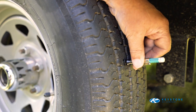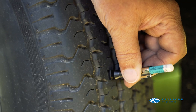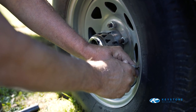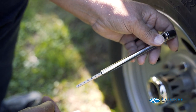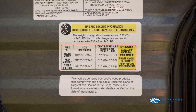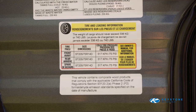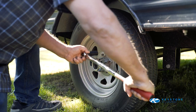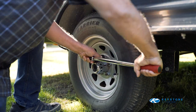While inspecting the tires, you're looking for uneven wear, flat spots, and damage. Check each tire's pressure and make sure it does not exceed the maximum pressure allowed. This can be found on the Federal ID sticker, either on the front corner of the driver's sidewall or the sidewall of the tire itself. Torque the lug nuts to the appropriate foot-pounds in a star pattern.